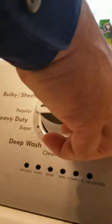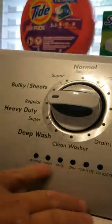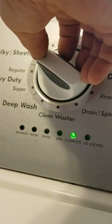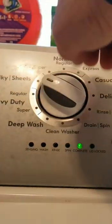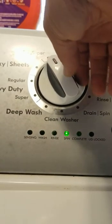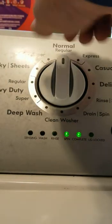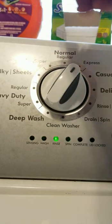...around back to the 6 o'clock position. You can go around twice, one time, three times — whatever you want to do — just end up in the 6 o'clock position. For the sake of this video, you could do it in any position, but this simplifies the explanation. We're going to go clockwise three spaces, counterclockwise three spaces, clockwise one space, counterclockwise one space. This all has to be done at a steady pace with no pauses in between — not too fast, not too slow. So here we go: one, two, three... one, two... back one, two, three. You need three back, then start going forward: one, two, three, one, two. All those lights will come on to let you know you're in diagnostics.